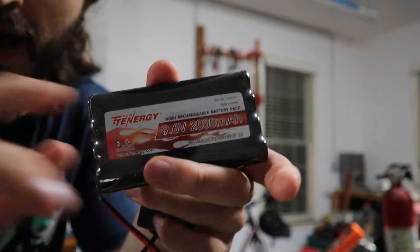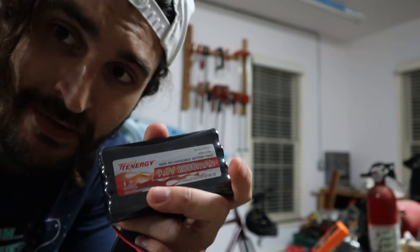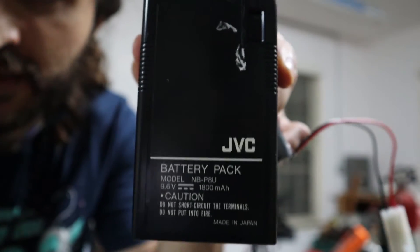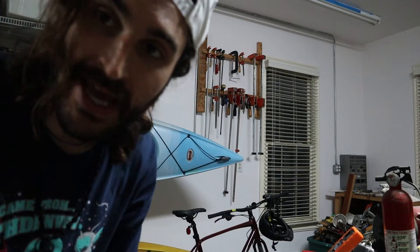The last thing you need is one of these battery packs — this is actually for RC toys. You need to have one of these battery packs with the Tamiya connector. This has to be the correct voltage of the battery pack that was supposed to be used for your camera. My camcorder is a JVC GRC7U from the 80s. The original battery pack is 9.6 volts, and this RC battery pack is 9.6 volts as well. If it's under the voltage, your camcorder won't turn on. If it's over the voltage, your camcorder is probably going to explode.